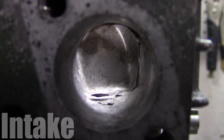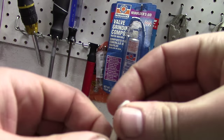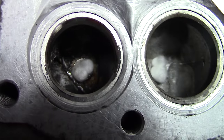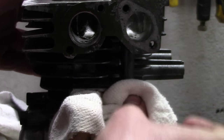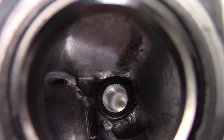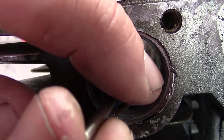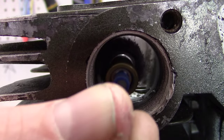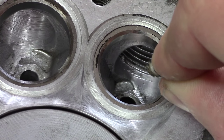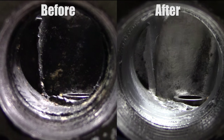This is the exhaust — it has all the junk in it — and the intake. All these little bits of casting and sharp edges are protruding. You don't want to have stuff going into the engine, so I just broke some Q-tips in half and shoved them down the valve guides and put a rag, aka sock, in there as well. Then I used this bit to grind out the casting. I roughed up the intake, polished up the exhaust. I mainly used this bit to rough out those sharp edges and remove the casting burrs and edges.